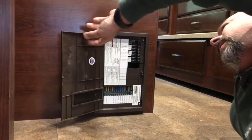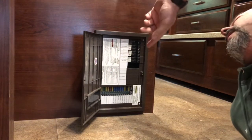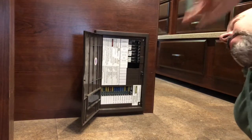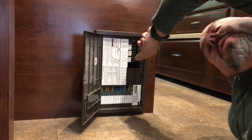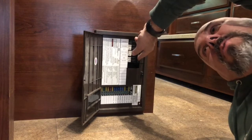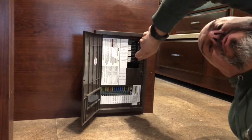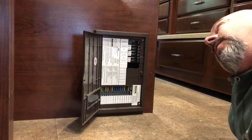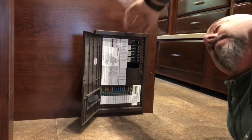So I'm back at the circuit breaker panel for my RV. You've got all the AC breakers up here and DC fuses down below. One of these — actually the one that says main — is a 30-amp circuit breaker. Typically when you plug into shore power it goes to this breaker first, which then feeds the bus bar behind it for all the other breakers. What I'm going to show you next is where I took the line coming in from the automatic transfer switch, from the shore power to this breaker, ran it to the inverter, and then ran the output of the inverter into where the shore power used to go. It sounds a little bit complicated but it's really not — I ran two wires in order to get that. Now the inverter will power all of these circuit breakers in the house. Doesn't matter which outlet, they all work off of that.